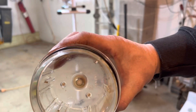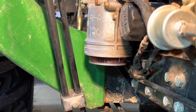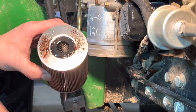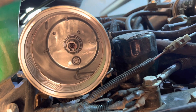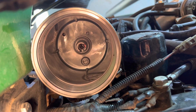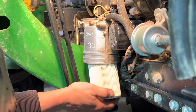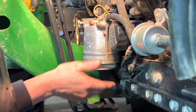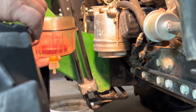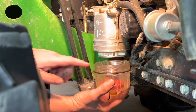The bowl is now nice and clean — make sure your O-ring is clean as well. Set it aside and change the filter. The fuel filter just pulls right out. This one had a lot of sediment on it. Inspect the inside to make sure everything is clean and there are no problems — that looks good. Put the new filter in; it should just push right into place. Then take the bowl, making sure the red spacer is in there to hold the filter in place, and spin it right back on by hand. Make sure the O-ring is clean.